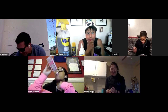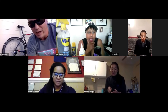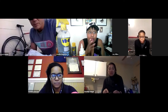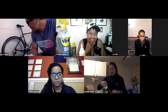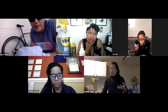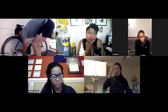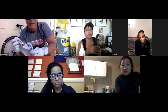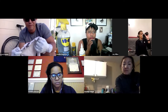First thing — if your bike is extremely dirty, the foaming degreaser can only do so much. You're going to waste a lot of cleaner if you don't prep first. Immediately just wipe the muck right off your chain — run it backwards, get as much off as you can for a good 15 seconds. This is the dirtiest bike I have — it's just one ride outside, dirt sticks to the lube. Get the big chunks of grease off first.